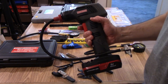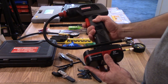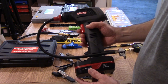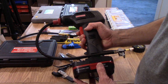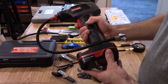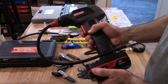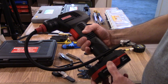This is one of the handiest tools I've ever purchased — it's a tire inflator. I take this with me every time I go riding and it's perfect for inflating dirt bike tires. It also works very well with the tubeless system; on that system you have to inflate the high-pressure chamber to 100 to 110 PSI, and this handles that very well. I think they quit making the Craftsman branded inflator, but this is actually made by Ryobi — I'll include a link in the description. It works very well on dirt bike tires and bicycle tires. It also works on truck or trailer tires, just takes a little longer.